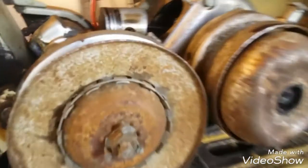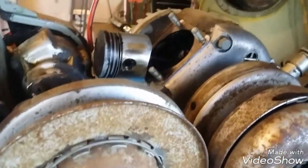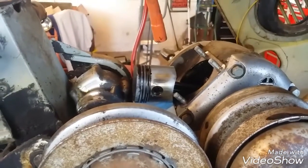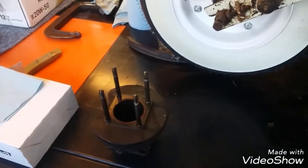I don't have new rings to seat to it, but that's what we got. I think my task now is to stuff that crankcase full of rags, start to clean up the piston, clean up that cylinder just a little bit, very lightly hone it, and then reassemble it and hope we have compression. Maybe we hear it run today — that'd be cool. I've had this for a couple years and all I've heard it do is sputter a little.